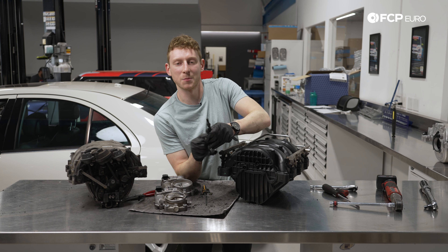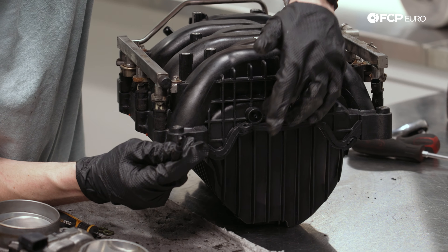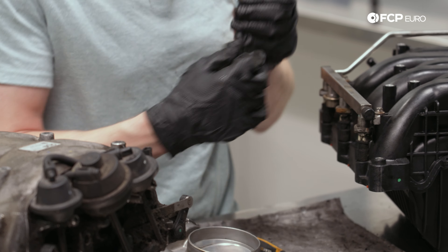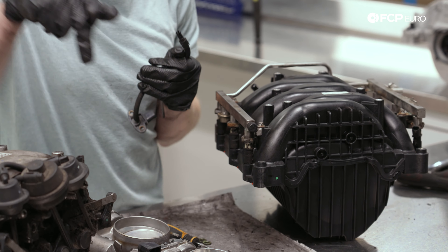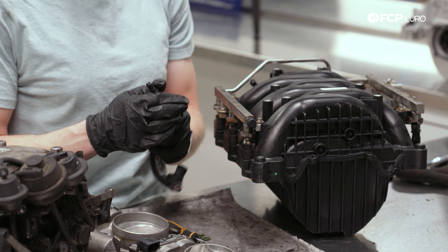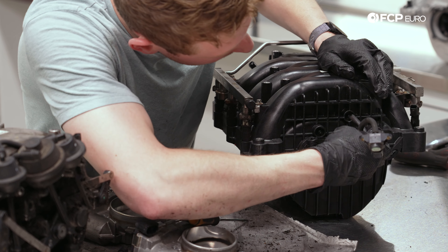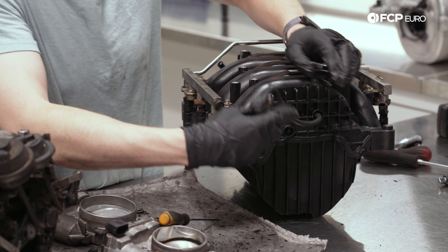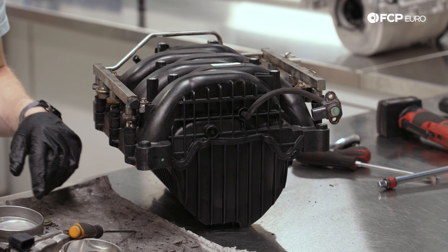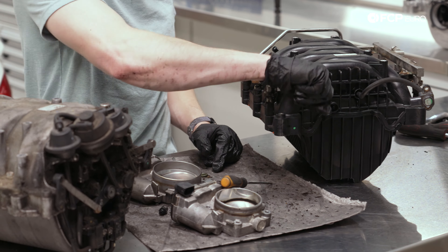Additionally, if you manage to get this plastic part off the old manifold without snapping it — for the M014, because it doesn't have a relief cut for this — you'll want to pull the plastic nipple off entirely so you're left with just vacuum line, then plug that directly onto the nipple here. On a new stock manifold you'll already have the plastic part attached, so you'll need to do the same thing. If you're using an aftermarket manifold, you can just pop it directly into the hole. MAP sensor goes right up top of the wiring loom and plugs back into its bracket.